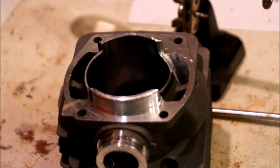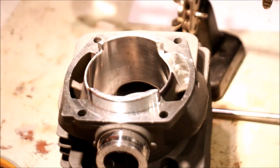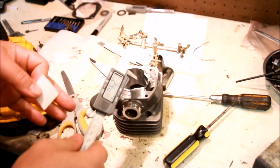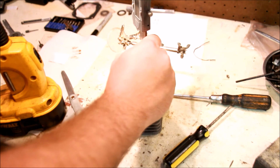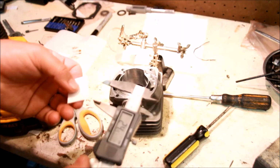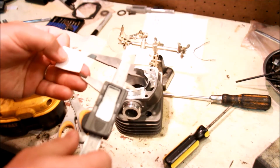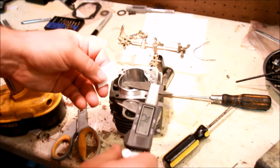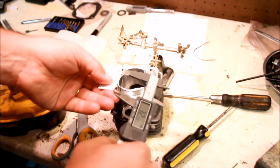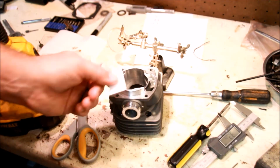You make a cut, 33 millimeters wide. Of course, you got to keep track of what's wide and tall and all that stuff, but whatever. Then you can also, of course, measure it here in the bore and figure out exactly how high. So 24.5 millimeters gives you roughly 101 timing from the squish band here. So 24.5 by 33-ish is where you want that.